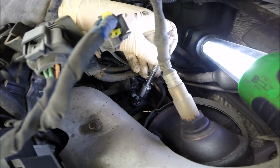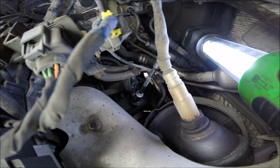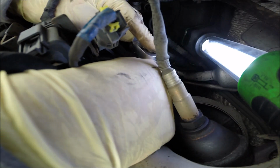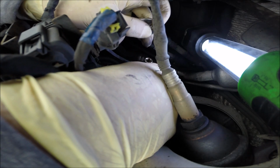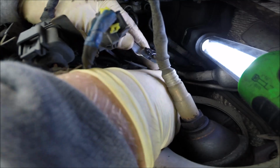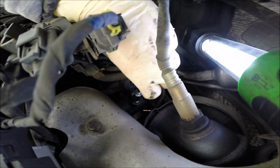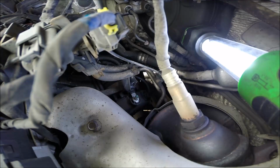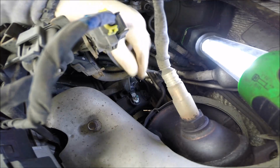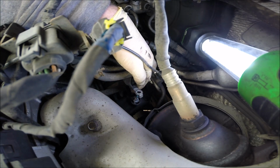Okay, so be really careful, don't touch the tools to anything else. If you don't feel good with this, like I said before, just disconnect the battery. The ratchet, same, it must not touch anything around. That is a little bit of a risky job, but if you know what to do, everything should be okay. That was the 12 socket. And now important, after disconnecting this, you have to isolate, actually not this place, just the cable, because there we still have the 12 volts.